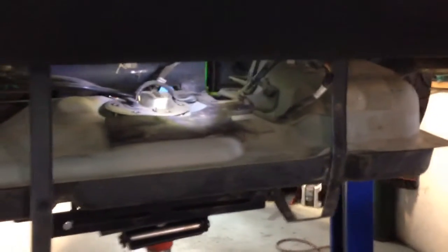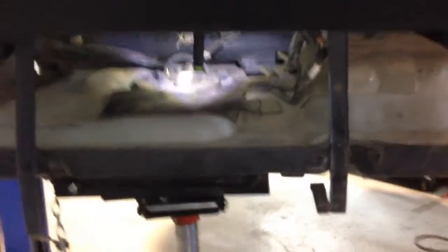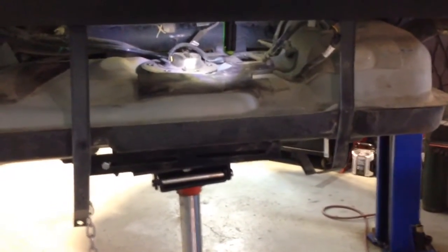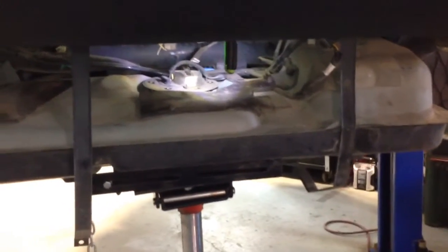You're going to see stuff like this after somebody puts a booster pump or something like that on there. I don't put booster pumps on cars — I don't bother with them. The only one I'll use is the one from JMS, and only if I really think I need one. I usually put an upgraded pump in the car with the proper FPDM and do the right thing — or put a second FPDM, run two pumps, and make sure they can both handle the amperage.